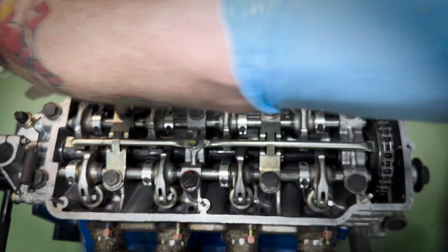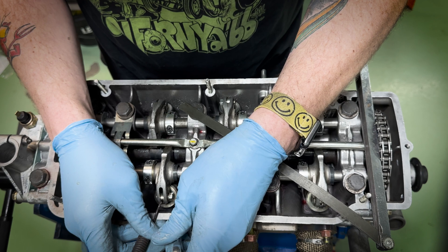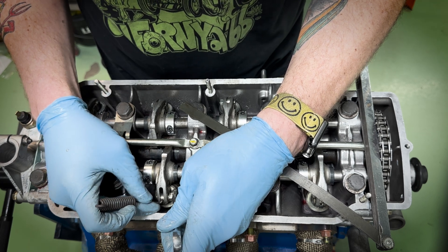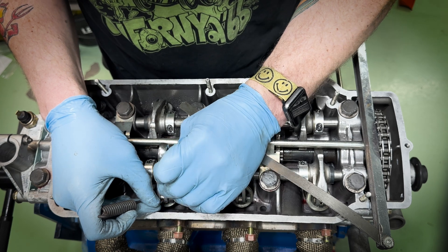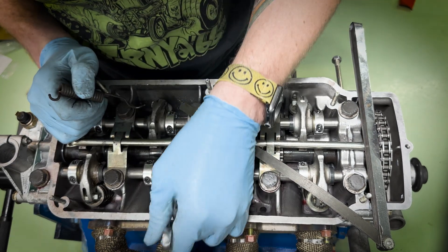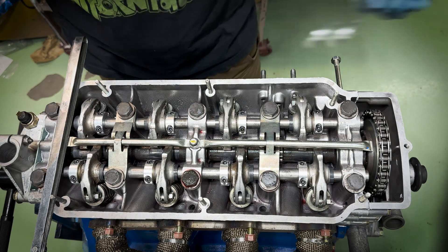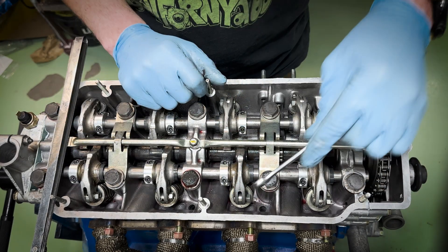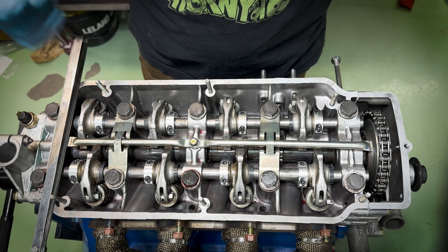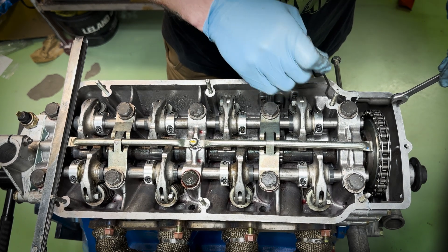Just a little looser, but I think that's going to work just fine. You could definitely tweak this until you get it just right, but no one has time for that. So I'm going to hold it and tighten that one down. That's about it for adjusting. Like I said, these valves are very simple - a little different than other engines in terms of rolling the eccentric cam on the rockers themselves, but it's simple. It's always good to check your valve lash anytime you can, because it helps keep everything running really well.